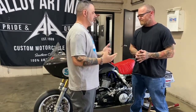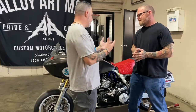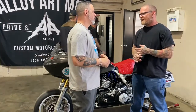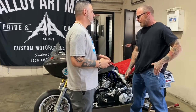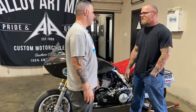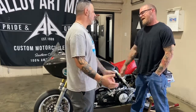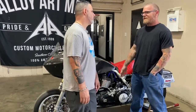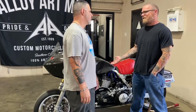And now you have these bikes — there are eight bikes in here that are all competitive bikes making big horsepower, and they basically put these things on a diet. What do they not do to these things? These have the stock frame, stock geometry. The frames are essentially unmolested. Basically it's just a matter of weight being shaved and suspension being upgraded. On the Alloy Art bike, we've got a lot of supplemental oil coolers trying to keep the temps down since they're running them so hard. Obviously these weren't intended to be put on a racetrack right out of the box — and we're proving that wrong.